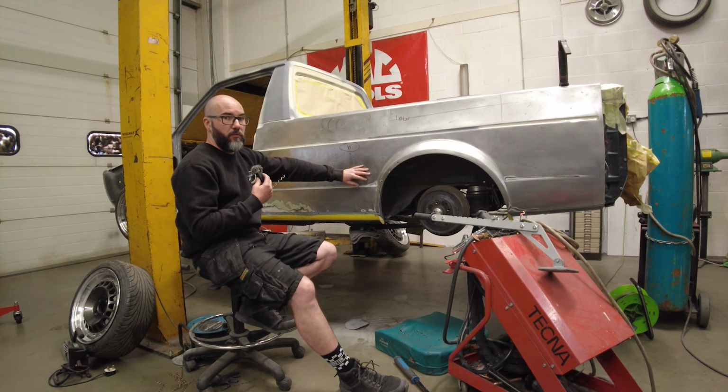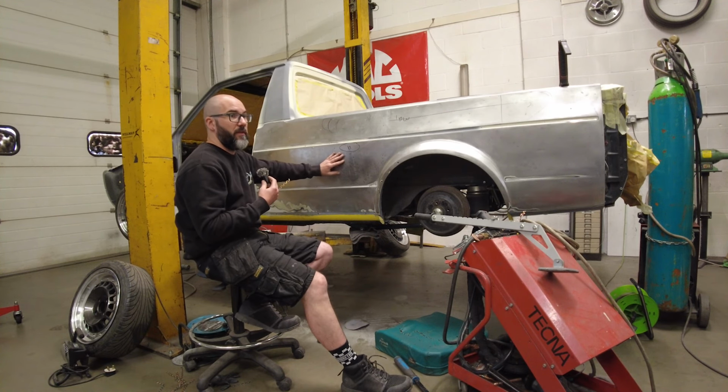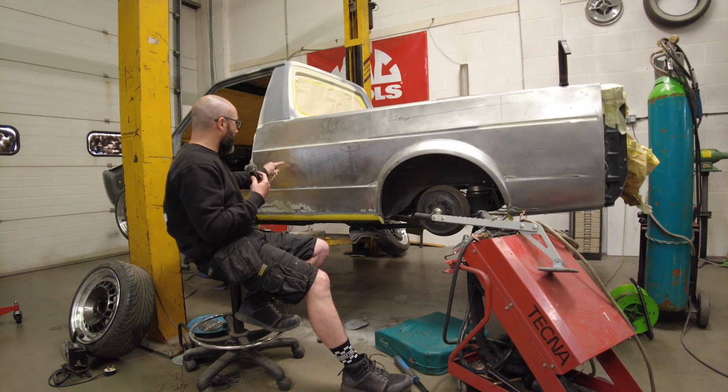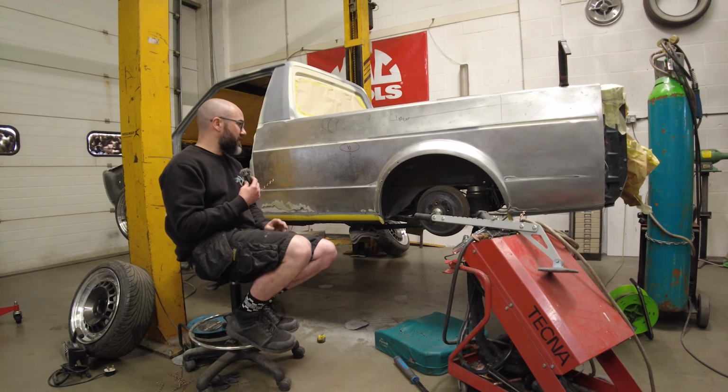Problem you have as well when you're working with wallows and huge dents is when you pull it back and you planish it and you metalwork it, then you fatigue the metal, and then you get oil canning, tin canning, where the metal pops. So I've negated all this now by using heat shrinking methods.